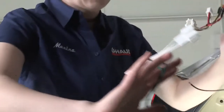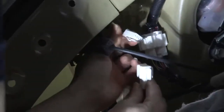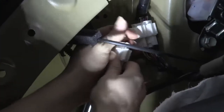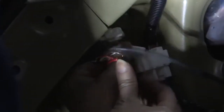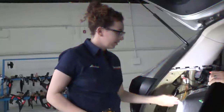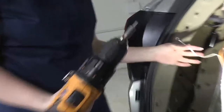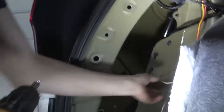This green one we'll use in just a minute to get to the passenger side, but for now we're just going to set that down. Bring our connector over. We're going to plug in the connector we just disconnected into our wiring kit connector. And now we're going to plug this one up into the top and click that right into place. Next we're going to attach this white wire — this is our ground wire. I have an electric drill with a self-tapping screw that we're going to use to secure the wire to the body of the vehicle here.